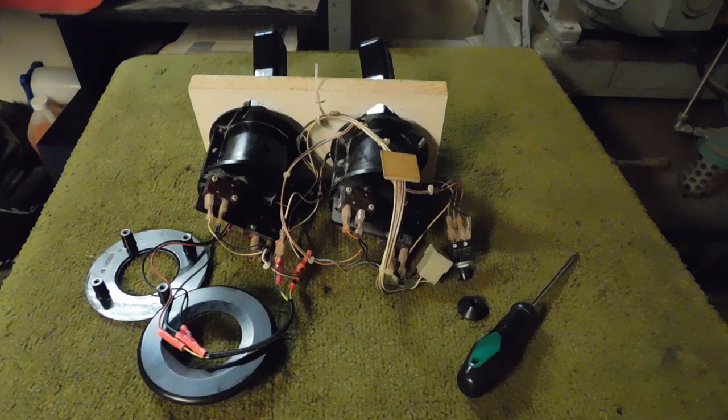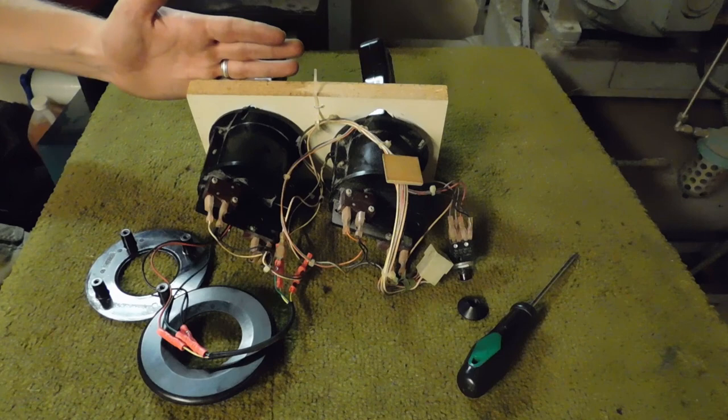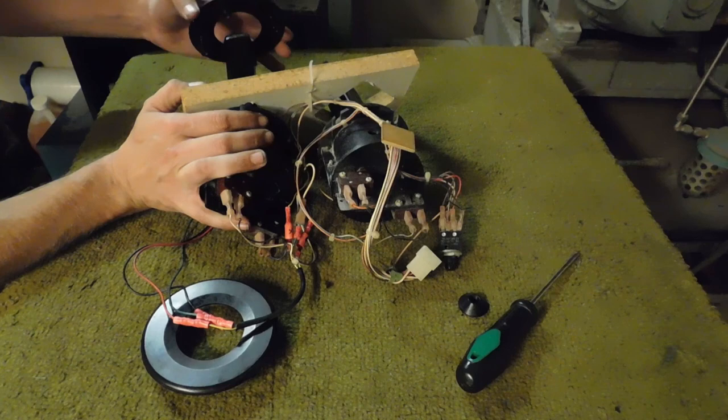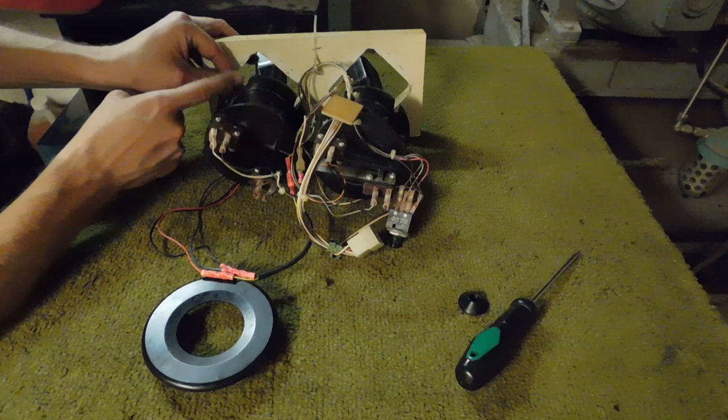And it's pretty simple. Because you have this piece of wood that's going to be right below the control panel. So imagine the control panel sitting right on top of this piece of wood, okay? And this piece of wood has two diamond shapes cut on it, just like in the control panel. So what's going to happen is we'll use these plastic rings here, and they are going to go right over the top of our control sticks, just like so. And these studs will go through the corners of the diamonds into these little slots that are cut into the bodies of the joysticks. From there,